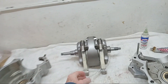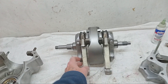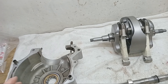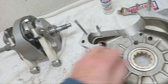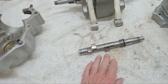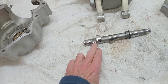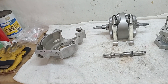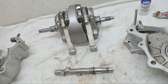The conrods are all done up now and we've protected them with masking tape. What we're going to do is assemble the crankcases. We'll put a lot of assembly lube on the main bearings and on the inner races. We've also got the camshaft and we'll be putting assembly lube on that and on the bushes in the crankcases. The camshaft was sent off to the engineers along with some other bits for his opinion on replacement.